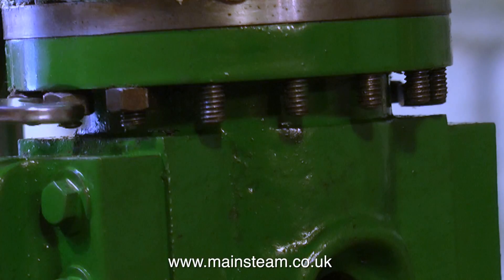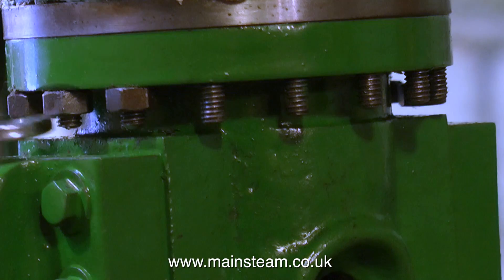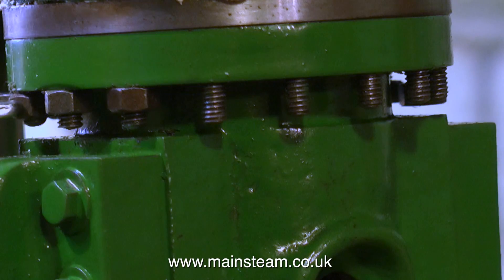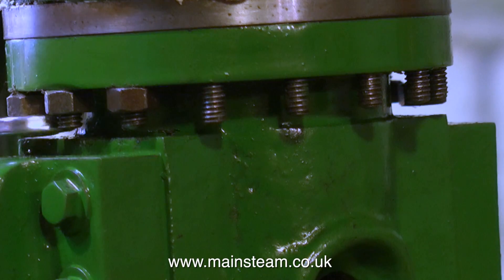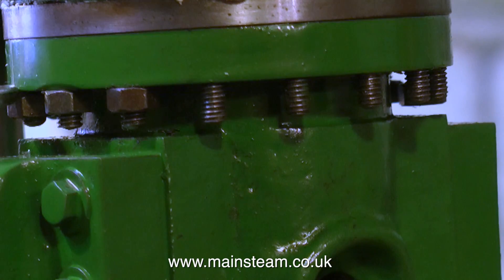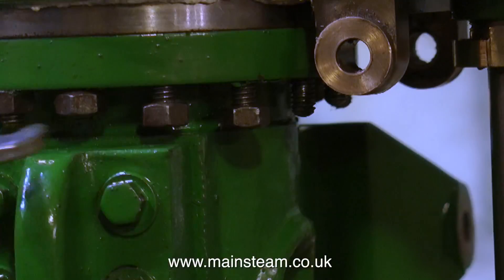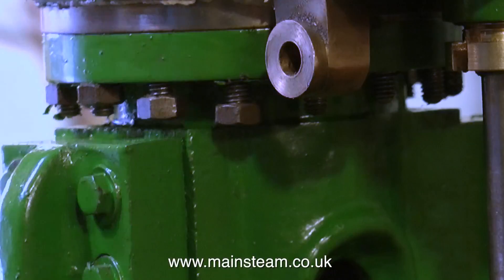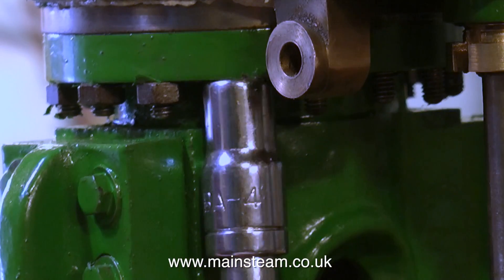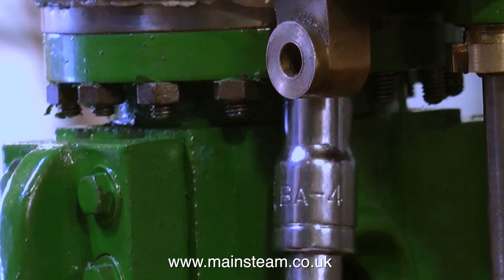It's not a good idea to dither either. You have to be positive, but don't put a lot of torque onto these nuts — they are very fragile. Six of the nuts on the studs over the stanchion supports at each side have to be tightened the hard way with a small spanner. The good news is once you get past these, you can fit a socket onto a screwdriver handle type fitting and tighten them up that way. But be aware that even a screwdriver handle socket can shear the nuts and studs.